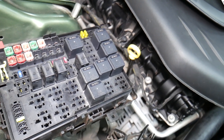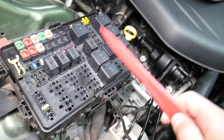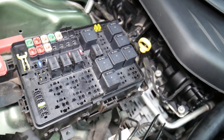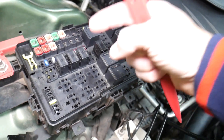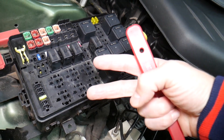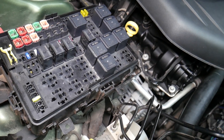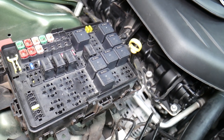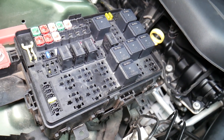For certain fuses, it's important to disconnect the car battery before removing them, otherwise you can burn the electronics. For instance, when working on airbag fuses, you need to wait at least one hour after disconnecting the battery. If you're not qualified and certified to work on the airbag system, I would never recommend doing that. Also, a common mistake when disconnecting the battery — it's important to know which terminal to disconnect and reconnect first. If you do it the wrong way, you can burn electronics and modules. We learned that the hard way by burning a traction control module on a BMW that cost $2,000. We'll put a link in the description on which battery terminal to disconnect first.